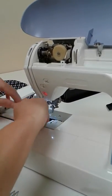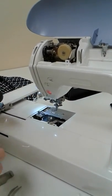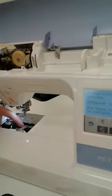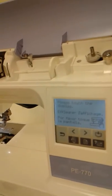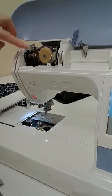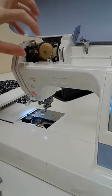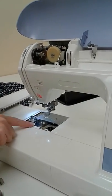Before I put the new needle in, I'm going to point out — he replaced something, but I don't remember what he replaced. He probably replaced that because he has to replace that a lot of times. Why does the thread get down in there when you're sewing and just jam up? Because we had junk in the tension disc, there was not enough tension on the top thread and it was just freely going down to the bottom. So anytime you have a problem under here, it's usually because of something going on up here. You want to keep that clean in there.